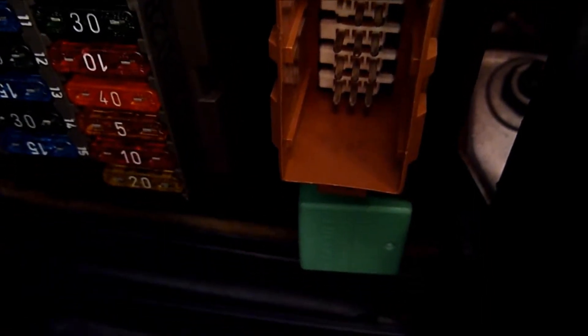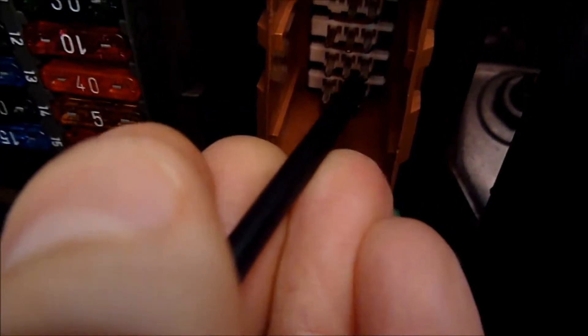So if you look here: that's A, B, C — and that's C2. So if you put that one to ground for five seconds, release it, and then you'll start receiving your blink codes, your flash codes. You can see there: that's row A, that's row B, row C — so it's that one, C2, you just put to ground for five seconds. And that's it, it's as simple as that.